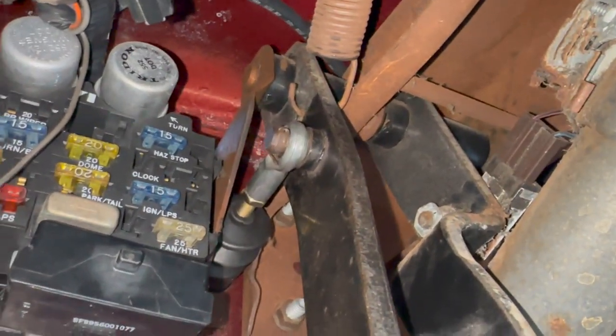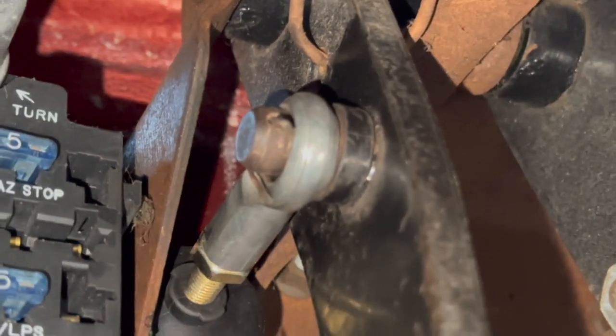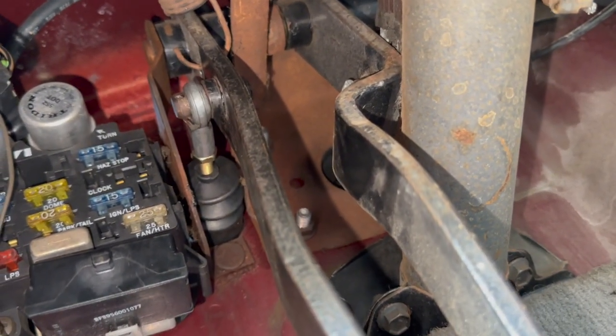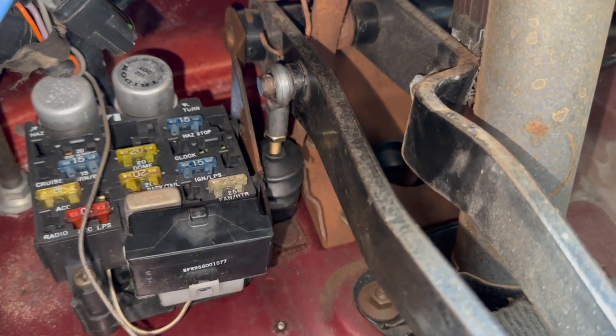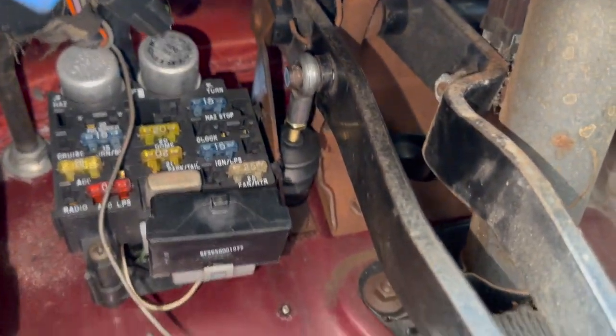Let me show the bottom. I need to put a better cotter pin in there — I have new ones. You'll need a good-size washer to seat it snugly; the original washer was too thick to fit with the other piece. It's all snugged in and not too difficult. I tightened down the master clutch cylinder to the firewall — just move the pedal to get it in. The pedal is super hard now, which is exactly what we're looking for.